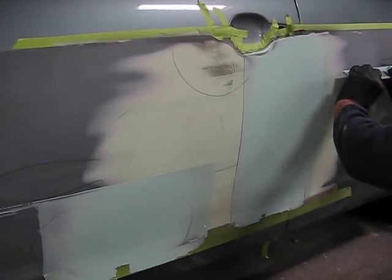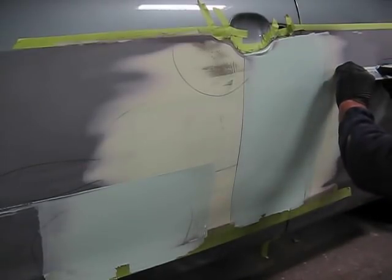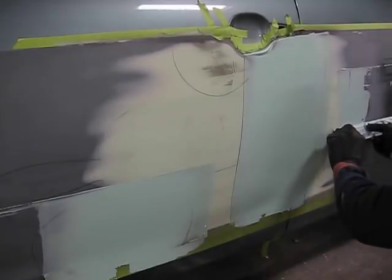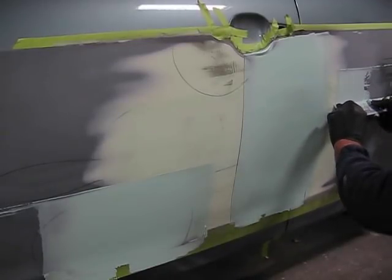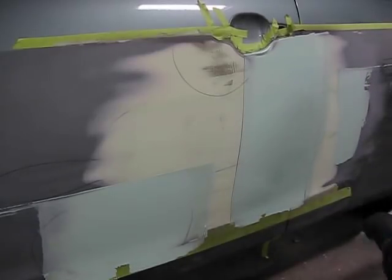Again, careful not to touch the area that I've swept there in the middle. You'll find a little bit of a hardened part of Bondo in there. We'll have to pick that out. You can see the line that is dragged down. Get that out of there and continue on with my sweep. This is a great way to move and organize the Bondo and to utilize it over the course of several sweeps. You can really utilize the material well.